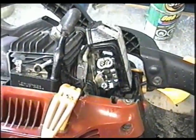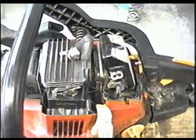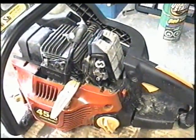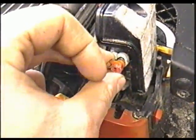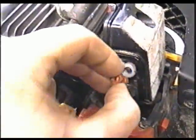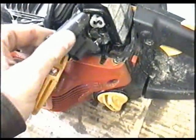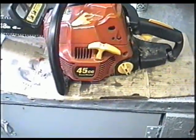What I usually do once I've set them is let them cool down and then do a cold start on them again just to see how they start. Once you've adjusted your carb, you can reinsert these bushings or inserts here and just pop them in by pushing in. Don't forget to put this boot back on here — it goes like that. And the last thing to do is just put your cover back on and screw that down and you're done.